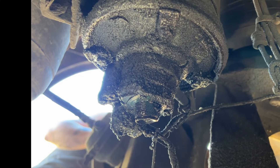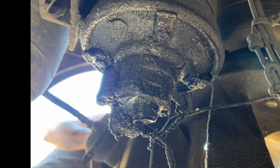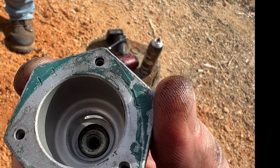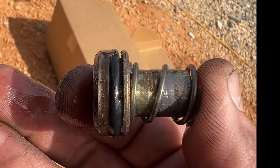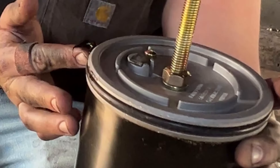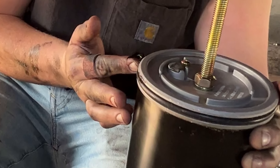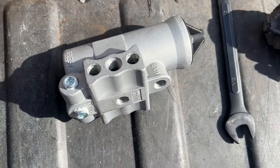The air system had tons of water in it. The air dryer was not purging — it wasn't expelling any moisture. We got into it and tore into the air dryer. We checked it, made sure there was nothing wrong with it, all the seals were good on the ejector, but we're going to rebuild the valve and get all new parts on it, plus a new desiccant filter. Then we've got to figure out why the air dryer is not purging — there's a signal coming from somewhere else. We're going to get into the governor and replace the governor.